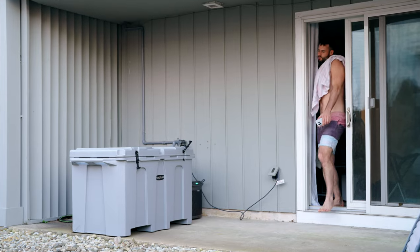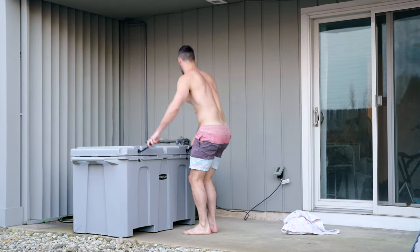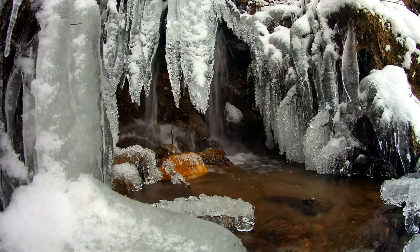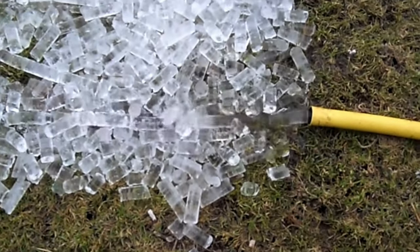It is highly recommended to keep this chiller under shade and away from the elements, which is not a problem for me, but it would be nice if it were outdoor rated — it, of course, is not. I have friends that leave it outdoors in full rainstorms and say their chiller is perfectly fine, so apparently you can expose it to some rain, but it's definitely not advised or recommended. One more thing to keep in mind — and this is really with all chillers and any moving water — is you can't use it in the wintertime. When ambient air temperatures get below around 32 degrees, you run the risk of freezing water, and if the water gets frozen in the unit, it can and will destroy it.